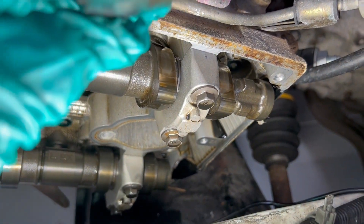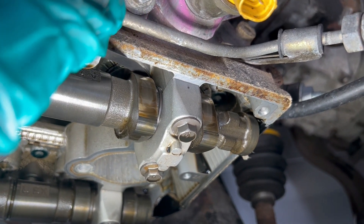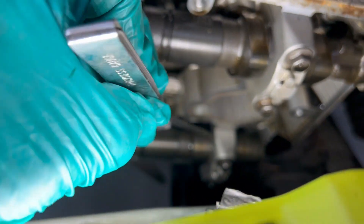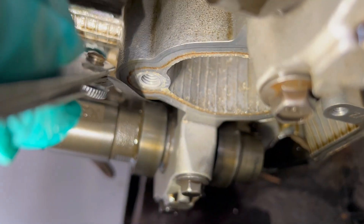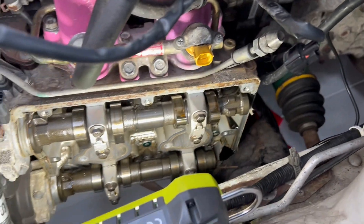The way you do it is by sliding your feeler gauge around the back — do it one-handed, follow the cam round. That slips around nice and easy. I think the top at 0.25 is nice and easy too. The bottoms — although the cam's in the wrong place — you check them in the gap. I've checked them all with both hands and they're okay, which is a worry because it's still making that noise.